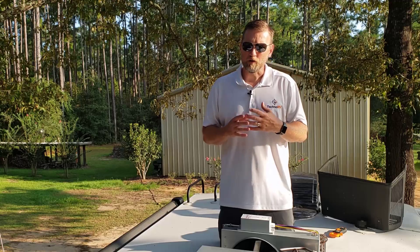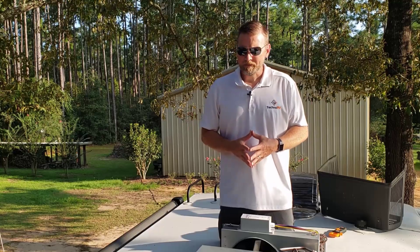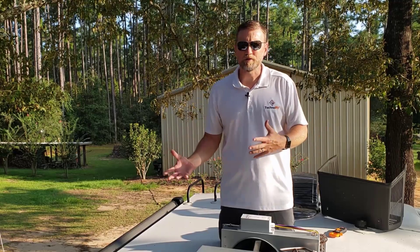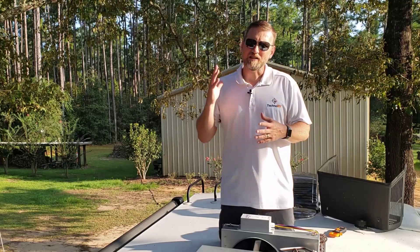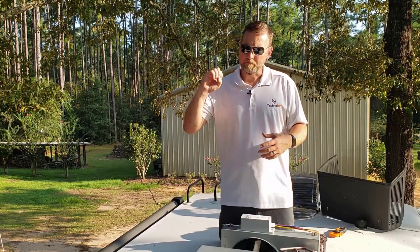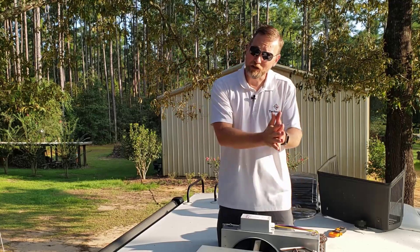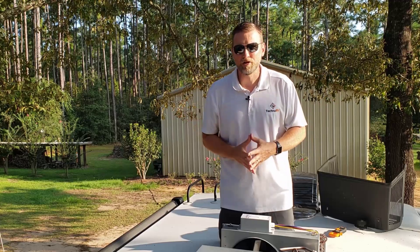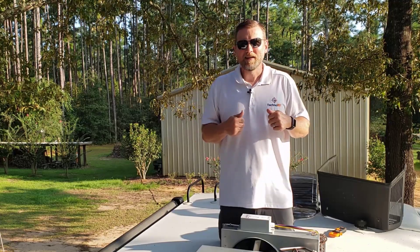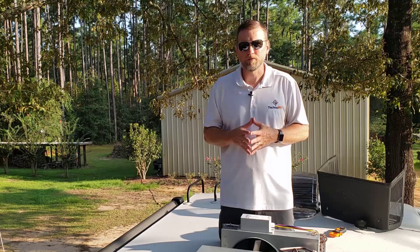The problem is whenever you start this unit up, it can really spike up to 50 or 52 amps. So if I was going to try to run this particular AC unit off the grid and wanted to start it with a smaller generator, that spike could actually create an issue. On bigger motorhomes made for 50 amps, if you're plugging into a 30 amp pedestal and would like to run two AC units, the limiting factor is that spike you get whenever you're starting these AC units up — not the 12 to 14 amps once they're leveled out and running.